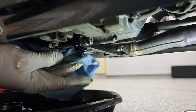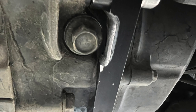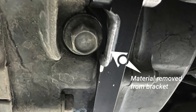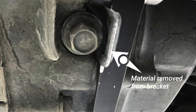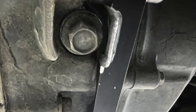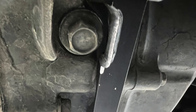You can see I've removed that rear drain plug even though I do have the traction bracket in place — that's because I ground off a little bit of material from that bracket. I think Traction is now shipping a modified bracket. I got one of the earlier models that kind of blocked that drain plug from coming out, but you can see that silver part — that's where I've ground off material on a bench grinder so that the drain plug and crush washer can come out much easier.